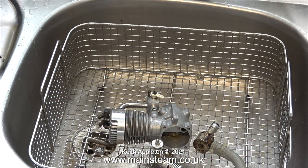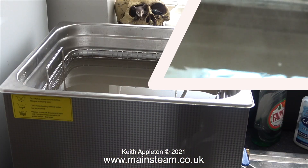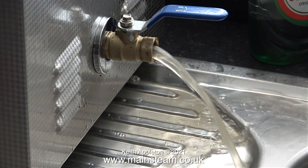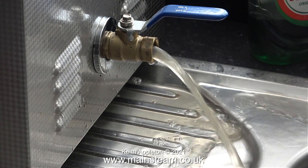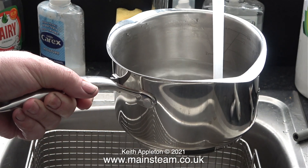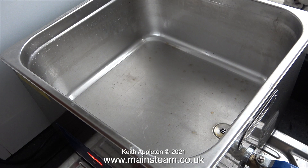To tackle the silencers I used some Scotch-Brite to manually clean the exhaust pipes, then along with the FS60 and another smaller engine I replaced the basket in the ultrasonic cleaner and set it for 25 minutes. Once the job was done it was time to empty the tank — there was quite a lot of residue in the bottom so as the tank drained I kept stirring it up with a paintbrush. It's really handy having this ultrasonic cleaner on the sink; being sat on the sink made it very easy to add more water to flush out the tank.